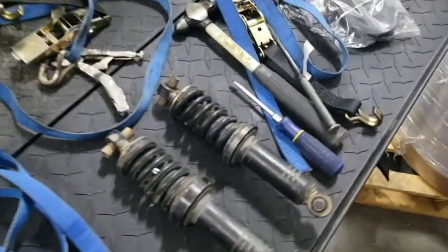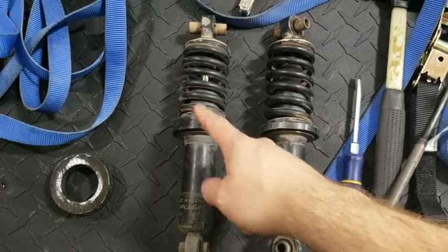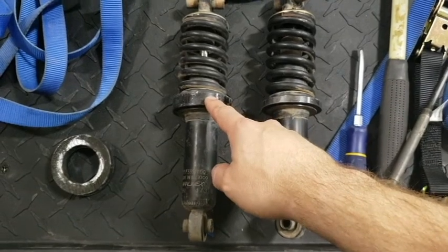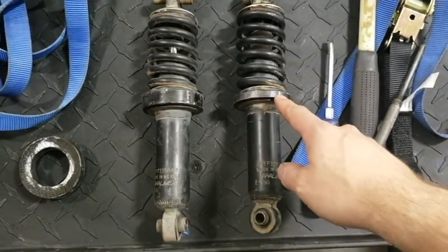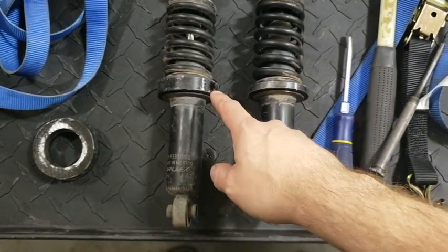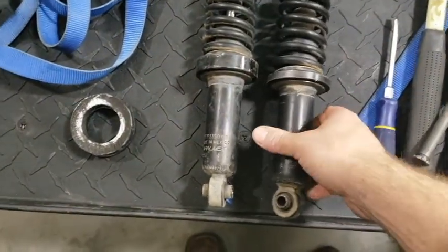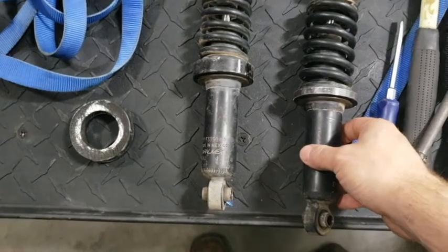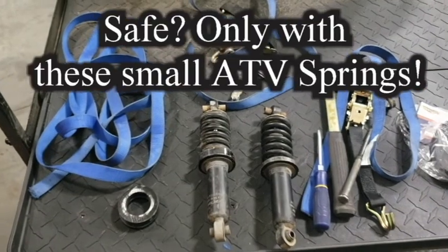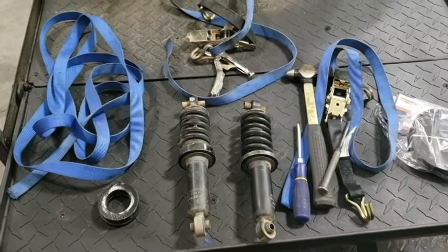I got them over here — the one on the left has a 5/8. I already added these and they're too wide. I need to go to half of that, which is 5/16. With the 5/8 I was getting positive camber, and with these I'm thinking it'll be just right. I'll show you how I did it with ratchet straps. It's pretty simple and safe — I've done this a couple times without any problems.